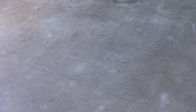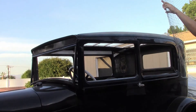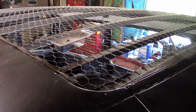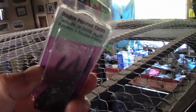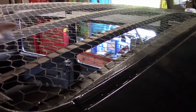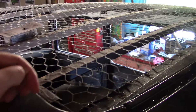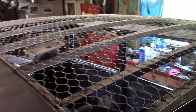Now it's time to install the chicken wire. This is what we took off the car. The top had already been replaced fairly recently, so this stuff is like new, so I'm just going to reuse it. I installed it with these double-pointed tacks — that's pretty much what they were held on with originally and they work pretty well. It's important to make sure these ends are not sticking up; I've got to go around here and make sure none of them are. Also, this should be reasonably snug when it's done, which this is, so we can move on to the next step.